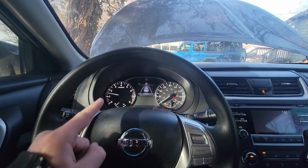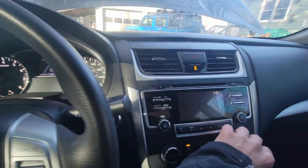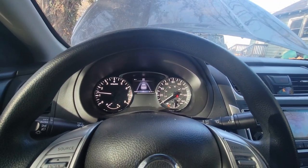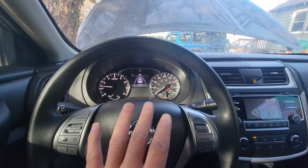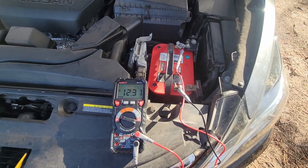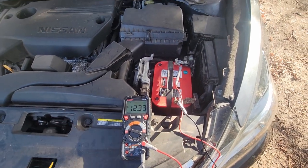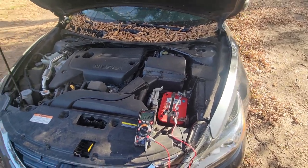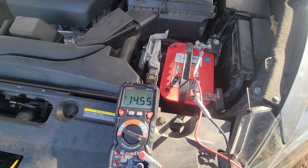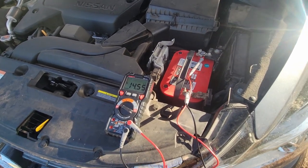I was hoping that little light was gonna tell me the problem but it didn't. You can tell the clock time is off — it's crazy. So we're going to turn the car off and check for parasitic drain. First we have the multimeter on volts, hooked up straight to the battery, car is off. Now turning it on — we want to make sure it doesn't drop below 10. Reading is 14.55 volts — everything looks good. Let's turn it off and move to the next step.